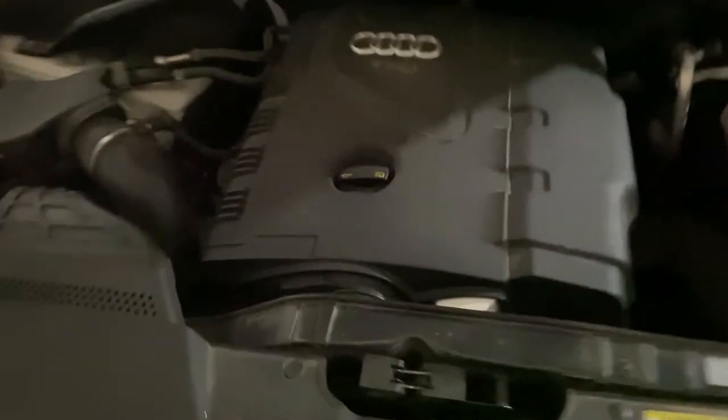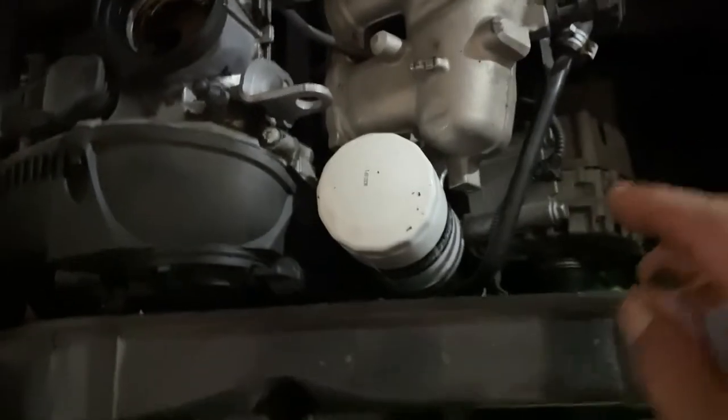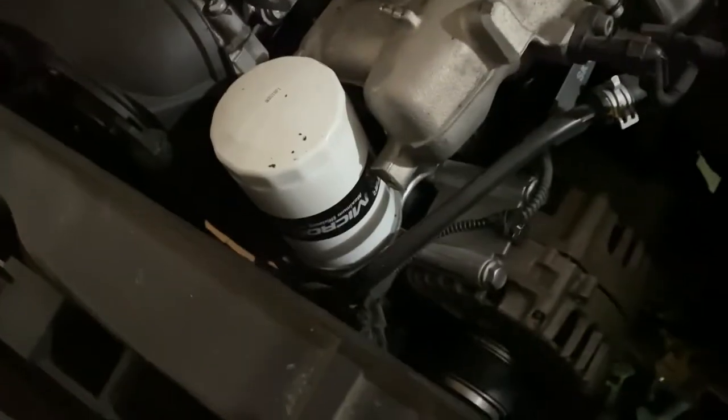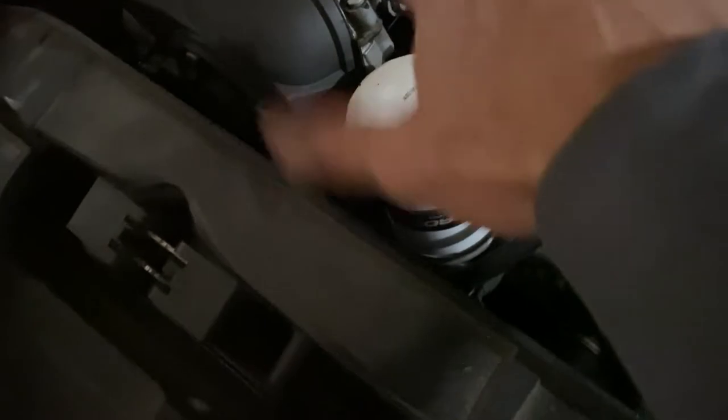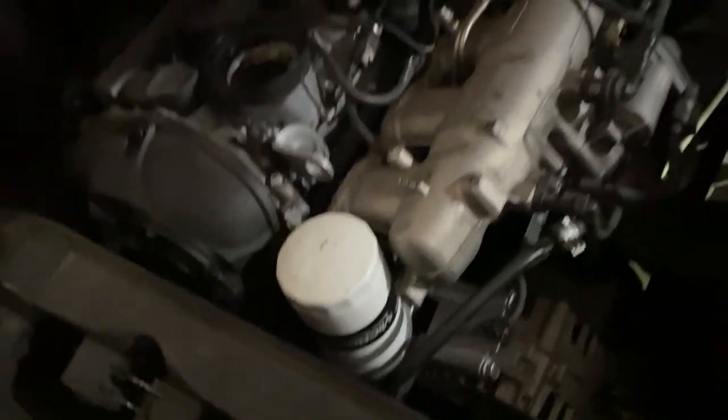I leveled the car. Also, what you want to do is open the oil cap a little bit to help drainage. You can also pop the hood open. There we go — now you have access to the oil filter as well. If you're planning to replace it, generally by hand you can unscrew it, and if not you use a filter wrench to get it off.